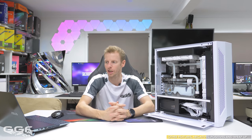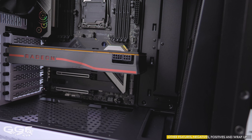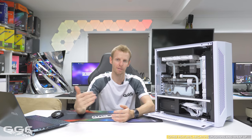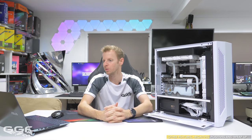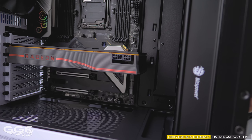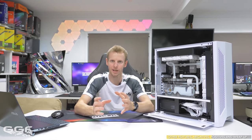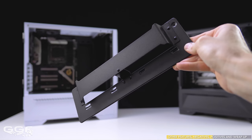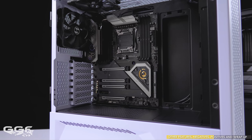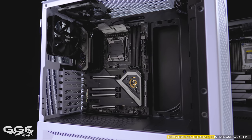One issue I did run into: running a thick EK radiator at the front will interfere with the cable management bar next to the motherboard — but only when it's in its EATX position, because it protrudes out so wide it gets pushed closer to the front of the case. When a thicker radiator comes in, they eventually foul. The EK radiator is roughly 130mm wide; I tried a Bitspower radiator that is 120mm wide and it just cleared. So your radiator width limit is about 123mm — but only if you're using an EATX motherboard. You can completely remove the cable management bar, but the issue is that the protruding section is pop-riveted to the main plate, so removing it leaves a large gaping hole, which looks a bit messy.